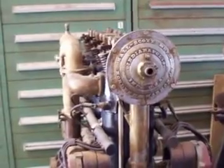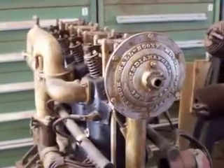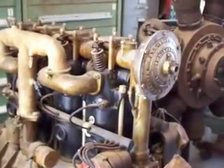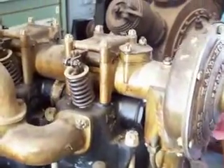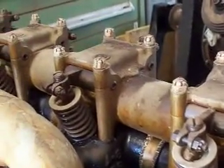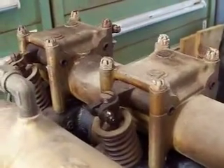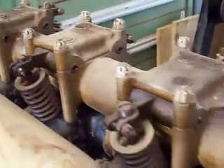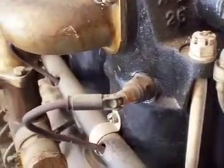Hall Scott Motor Company. Now this part of the engine holds the gearing to drive the camshaft. Here's the bevel gear — there's the drive from the crankshaft up to here. It goes in and drives via bevel gear, one-to-one there, then this drive reduces it to one-half so the camshaft turns once for every two turns of the crankshaft. That's just how a four-cycle engine works.